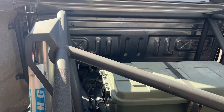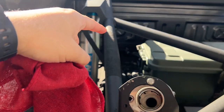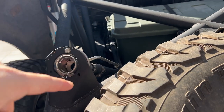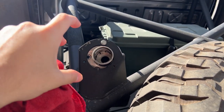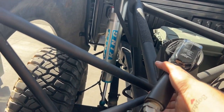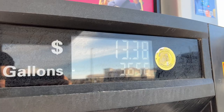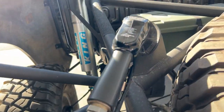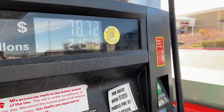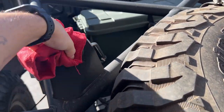You can see all the way in the front there's my stock factory gas tank. Normally the gas filler would be over here in your bedside but mine's sealed up, so I have some tubing — rubber hose — that goes from your factory filler all the way up and it's just mounted along my bed cage and bolted in right here. There used to be a filler tube but I was having smog issues, so that's a factory filler neck now that I mounted there. Now everything works like stock, and since it has a return line it'll do an auto shut-off. 21 and a half gallons — 78 bucks — and this is a 24-gallon tank so that's not too bad.